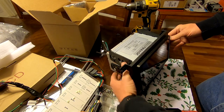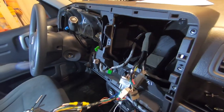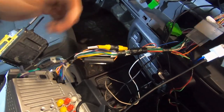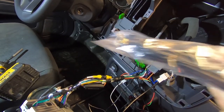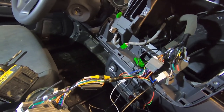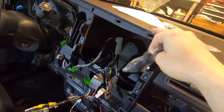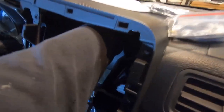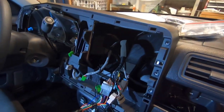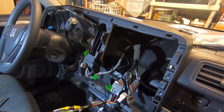When making wiring connections, all the standard colors apply on the included harness. Also included with the unit are two 4G antennas — for best performance mount those up in the windshield. There's also a GPS antenna, which will mount under the dash; it doesn't need to be on top of the car, just under plastic and not under metal. Some people run it out and place it up here. There are also a couple of USB extension cables included.